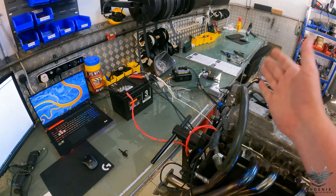That is all the testing of the ignition and injectors. I'm not doing a very extensive video here - I do have videos on how to test your inputs and outputs. The reason I tested the coils and injectors is I cannot remove the injectors one by one when the inlet manifold goes over the top, and I can't run the engine with these coils because they don't fit underneath the intake. I wanted to do those two tests to show you they work. Now I'm going to put the intake back on, get it up and running, get up to temperature and then we'll come back and we'll be able to see all the information - intake air temperature, coolant temperature - on the actual ECU software.